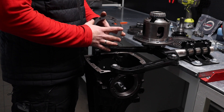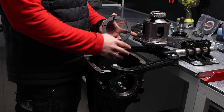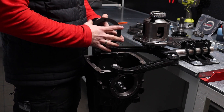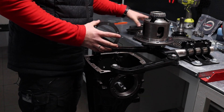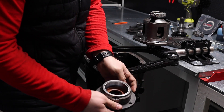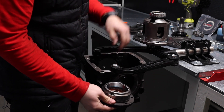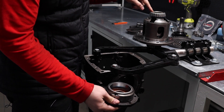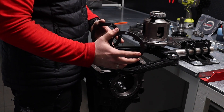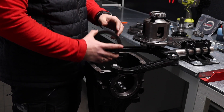The key point is to determine the overall thickness of the side shims, or adjustment shims as you want to call them, because you have the new carrier unit in the old housing. These shims dictate the preload and position of the carrier unit, which is important for normal functionality of the differential. When you have the side cap on, these shims go here, and their thickness dictates how far the bearing cone can penetrate into the housing, creating pressure on the bearings. The sum of the right and left shim thickness will dictate the preload on the unit — this is the key point to adjust first.